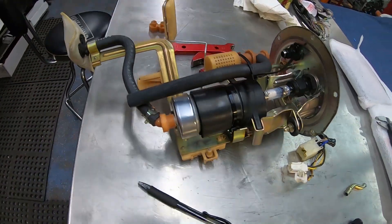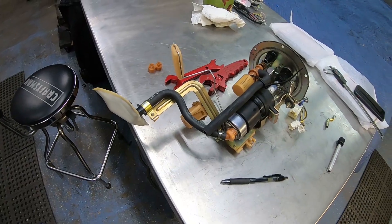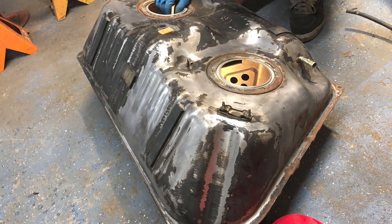Saddle tanks can store fuel on both sides of the drive shaft, or both sides of the car, the right-hand and left-hand side. But commonly from the factory, the fuel pump itself is only installed in one side of the saddle. And then the question becomes how do you draw fuel from the other side of the saddle without just going around right-hand turns or left-hand turns really fast to make the fuel slosh over the hump in the middle?